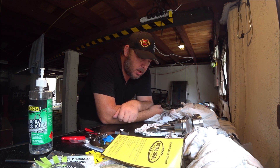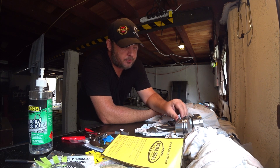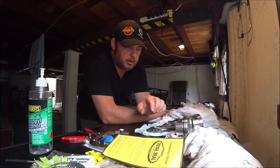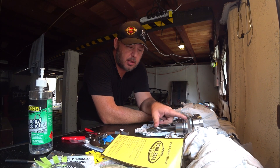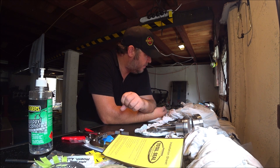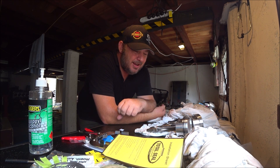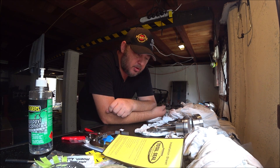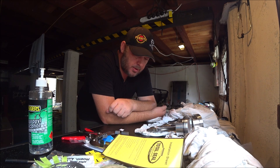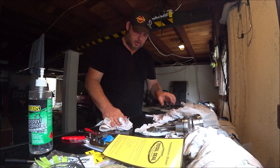So that's installing the rings — pretty easy. The only reason I'm not doing this by hand on these pistons is I don't want to scratch the piston with the ring as I pull it on and off. These are quite expensive and they're machined the way they are for a reason, so I don't want to undo that machining by scratching it with the inside edge of the rings. Five to go, then job done.